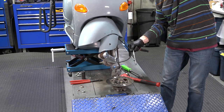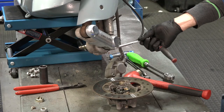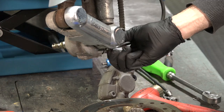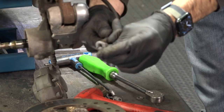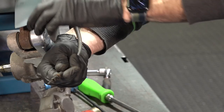Next we're going to go ahead and loosen the cable. You have your speedometer cable that goes right in there. There's an eight millimeter fastener that holds the screw. If it's really tight, you're going to need to put some heat on this because grease or corrosion sometimes gets to the threads. Remove the screw — it's an eight millimeter screw with a little wave washer. Then we can work the cable out. It comes out of a rubber bushing right there. We have this little plate that will separate. Let's see if this cable does anything — this cable does not even turn. The last thing we want to do is run this speedometer drive with a new gear, because this will strip the brand new gear.